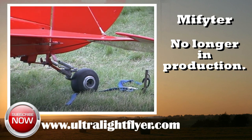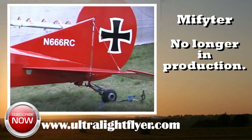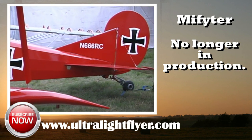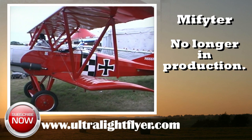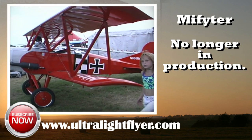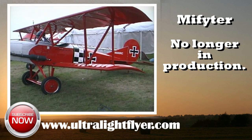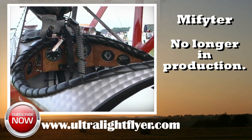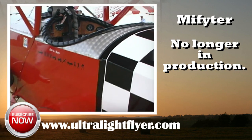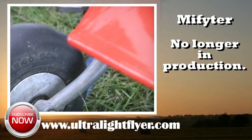It's going to get off the ground at awfully close to 100 feet. It's going to depend a little bit on your altitude and a few of those kinds of things, but in about 100 feet you're going to get airborne. You're going to get somewhere in the area of about 1,300 feet a minute climb, you're going to want to fly the airplane at about 75 miles an hour for cruise, and you're going to get somewhere around 95 to 100 miles an hour on the top end.